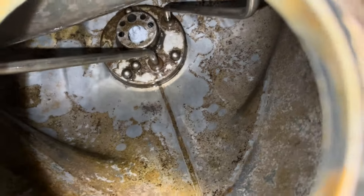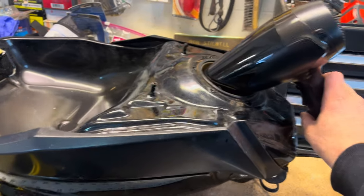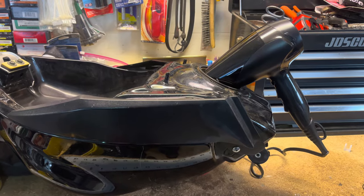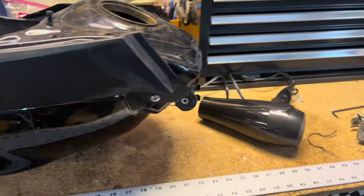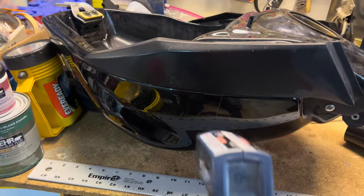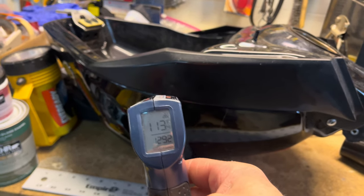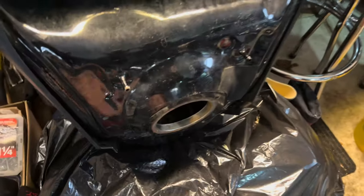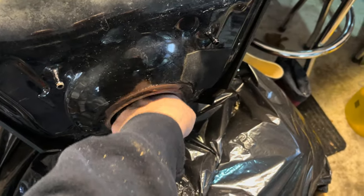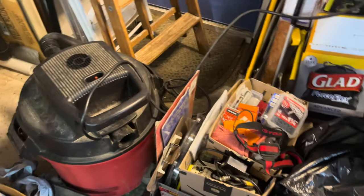The vinegar should get rid of the rest of the rust. We're going to use the hair dryer — I'll let it run for probably 15 to 20 minutes. After the hair dryer the tank is obviously pretty hot, showing about 130 degrees on the metal. There's still a little water left in the bottom even after the dryer, so I'm going to use the shop vac and compressed air to get it out as much as possible.